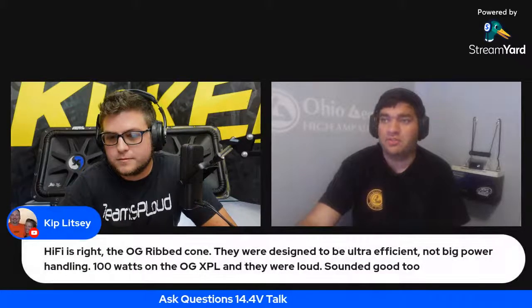Yeah, $250 too. That's a good deal. Right, because it's not just a DSP; it's an automatic DSP. You know what I mean? You don't have to do anything. You just go in there, boom. Throw some pink noise on, you're good to go. So yeah, they're definitely awesome. Plus they're little powerhouses. It does 500 watts at 1 ohm and like 300 watts at 2 and 200 at 4 or something like that. I'm looking at the 4-channel one. The 4-channel 204. Yeah, 50 times 4, which is way more than a stereo does.